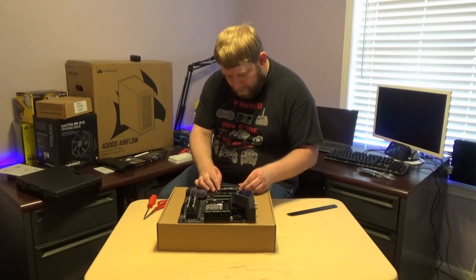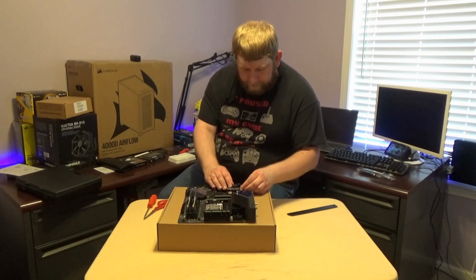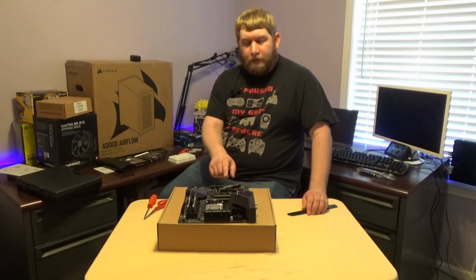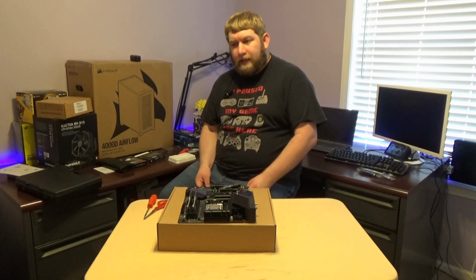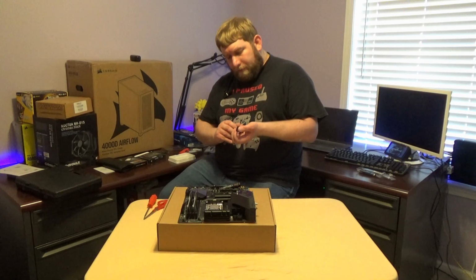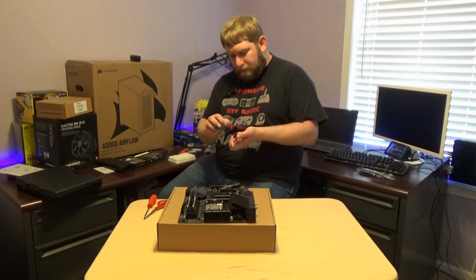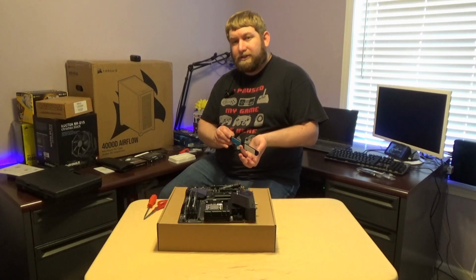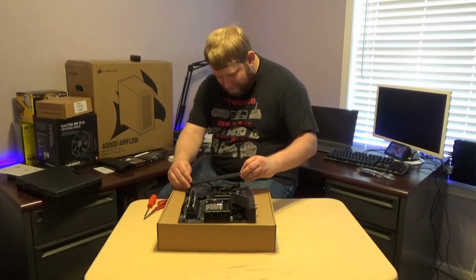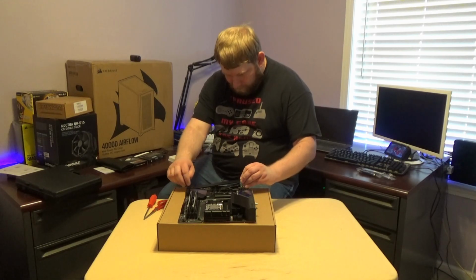let's put this at a 30-degree angle, I believe. There we go. So it's lined up. Just make sure if you're using a longer one, there is no standoff at any of the smaller locations. I cannot remember the 3 sizes. The last one is a 2280, which is the current size that I'm using. And you want to make sure that the standoffs are not making contact with any part of the board itself, of the M.2, because then it can potentially short it out. I find it very amusing that the M.2 literally just sticks up in the air until the time at which you go to screw it down.